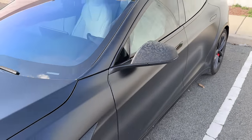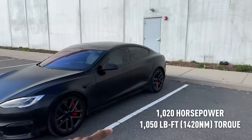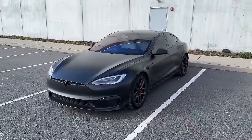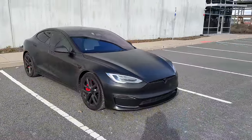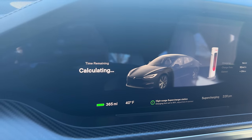The basics as far as specs: this is a triple motor powertrain sedan from Tesla — one motor between the front two wheels and two motors between the back two wheels. It'll do zero to sixty in two seconds on a prep surface; it's a monster in a straight line. When I first got it, it showed about 390 miles on a 100% charge. Now at 30,000 miles it shows about 365 miles, so about an 8–10% range degradation, which is close to normal.